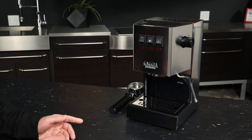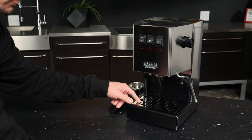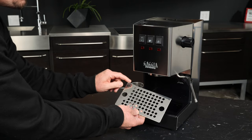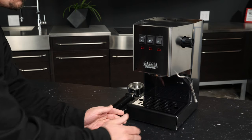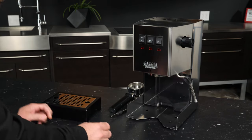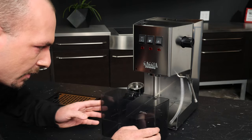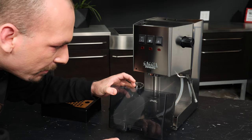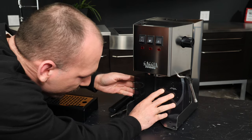Make sure your steam wand is angled out. This tube right here is called the decompression duct — when you're done brewing your shots, water gets dispensed through here down into the drip tray. On the drip tray screen in the top left corner, there's a little hole that the duct lines up with, so when you put it back you want that hole in the top left. This whole drip tray assembly comes out. The reservoir has two tubes — the longer one is the water intake and the shorter one is the return line. When putting the reservoir back in, it helps to tuck the tubes like that and then slide the reservoir back in.